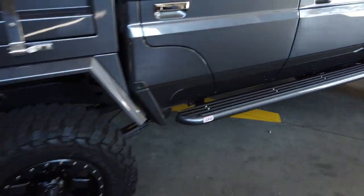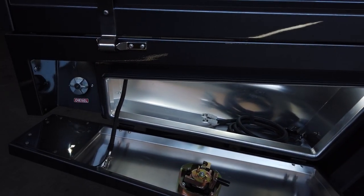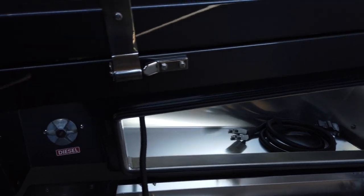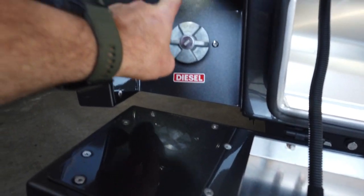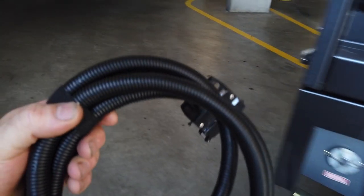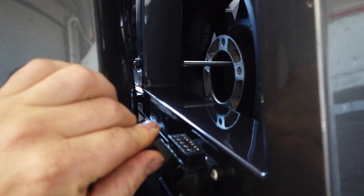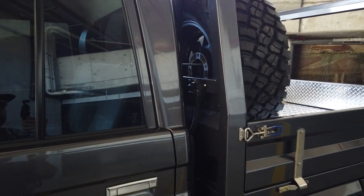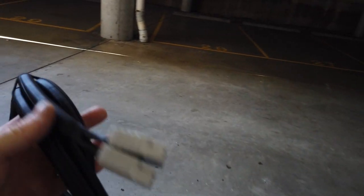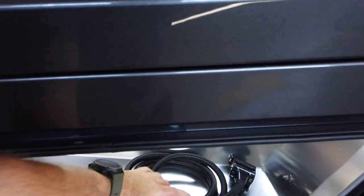One-piece mudguards, again all color-coded. In the toolbox we've got automatic lighting — you might notice that light coming on and off. We have the fuel filler right there, and it even has a little light under there as well. We've made up a little patch lead — the owner is not getting a canopy right now, but in the future he is going to be purchasing one. So we've already installed our canopy plug here. That 12-pin plug will get your rear-view camera working, the fridge power, internal lighting, and central locking if he wants it later on. If he wants to chuck a fridge in the back or some spot lighting or whatever, he can just use the canopy plug to access the power.